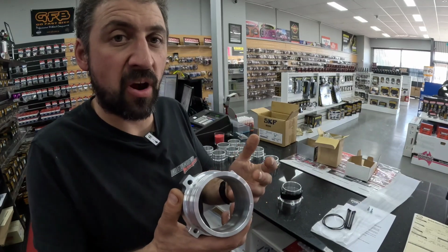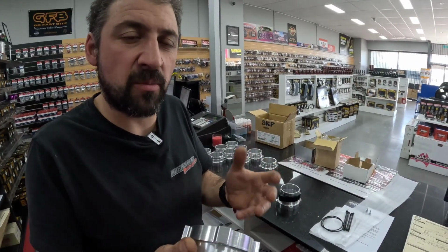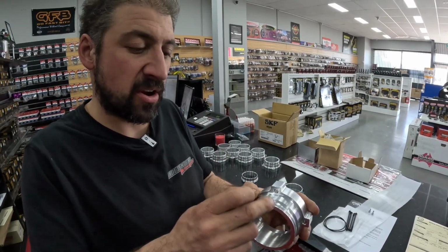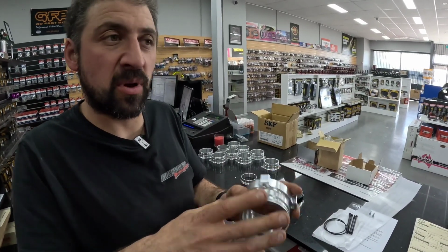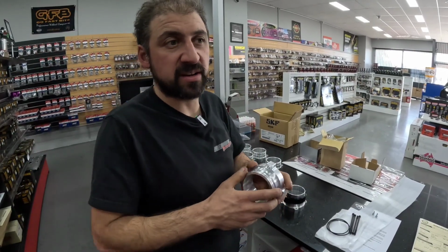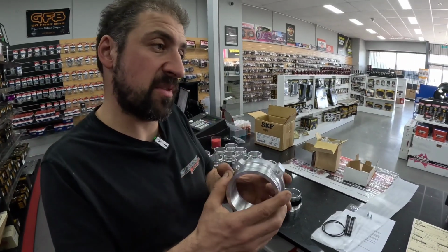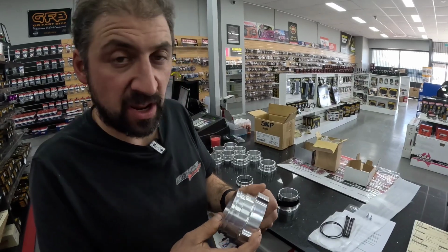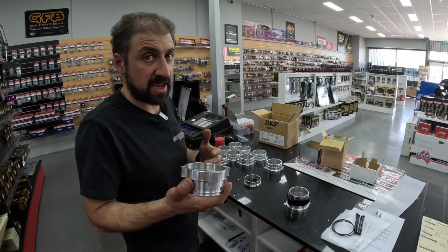So most people generally upgrade to an FG throttle body, which we sort of try not to do. I'm actually happy with the B Series throttle body, but the biggest issue with the B Series throttle body is they don't have enough purchase area on the actual throttle body itself to clamp the actual pipe on. So once you start getting some decent boost in, they just blow off all the time, and it's so hard to get it right. Most people just give up on that. So there is a market definitely there for these things, and we figured, you know, let's bring them to market. And yeah, we've been running these on our territories for years, and we've literally just got them back in stock now, which is great.